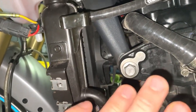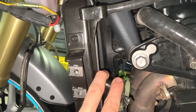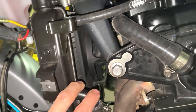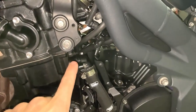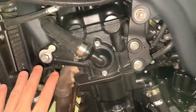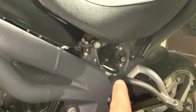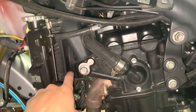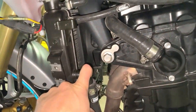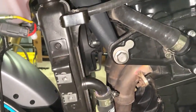It only works on and off. It's only one speed. It's not variable. It's just on or off. And that happens because somewhere there is a temperature sensor here. And when it says, hey, it's 103 degrees, then it gives a signal to the ECU, which you can find there. The ECU will turn on the fan. And then you will cool down until 96 degrees.